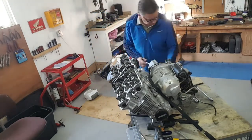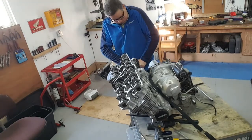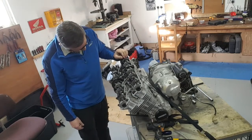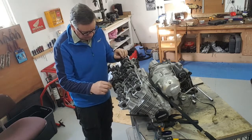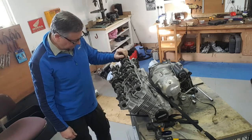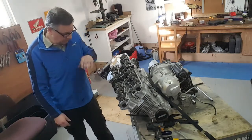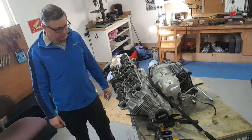Let's just see if this motor will turn over at all. Completely solid, that motor. I've got to figure out what to do — I may have to cut the cam chain, which is a possibility. Under the circumstances, that's probably the easiest option: cut the cam chain and I can just take the head off without removing the valves. So I think I'm going to proceed down that route.